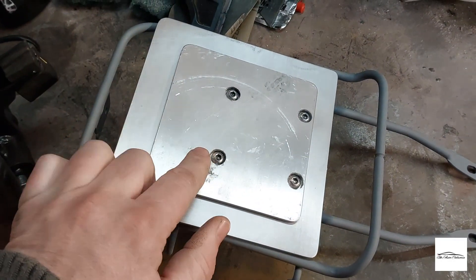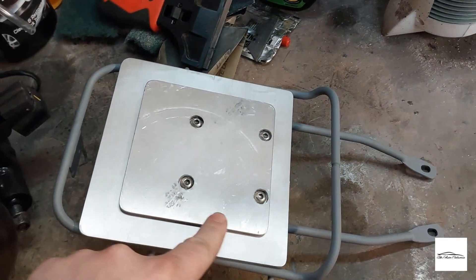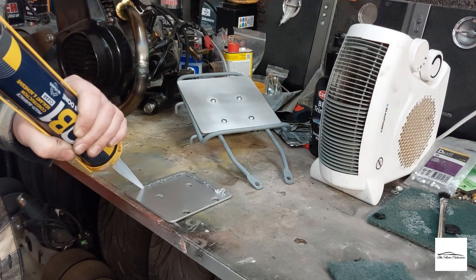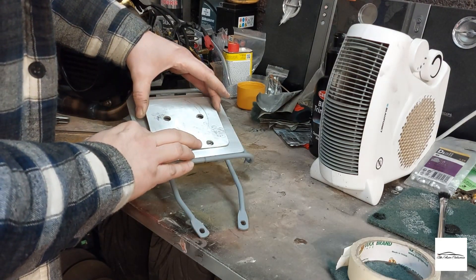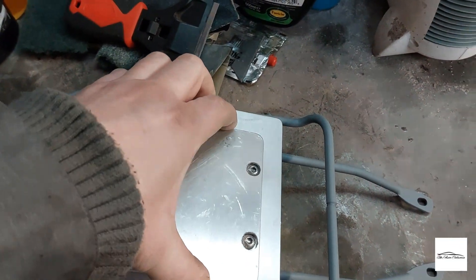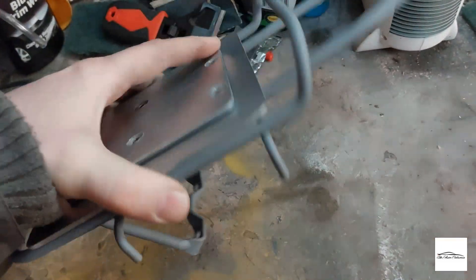So this is what I've come up with - it's two bits of aluminium plate. I didn't want the head of the bolts to sit proud, otherwise it would pivot, so I've glued this using the same adhesive silicone I used to glue the long nose onto the headlight cowl. This is now absolutely solid. I left it nice and secure with masking tape really tight around it overnight. It is absolutely rigid, and if I remove these P-clips I can run just the luggage rack on its own.